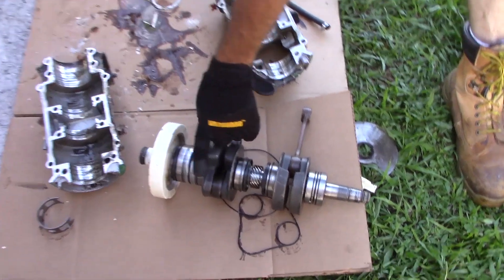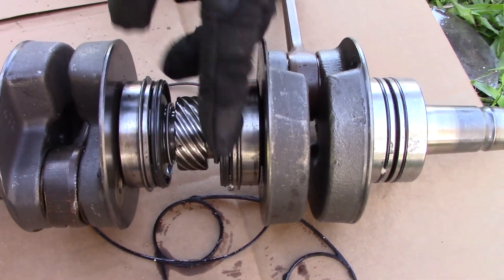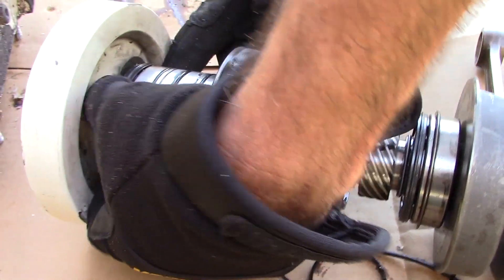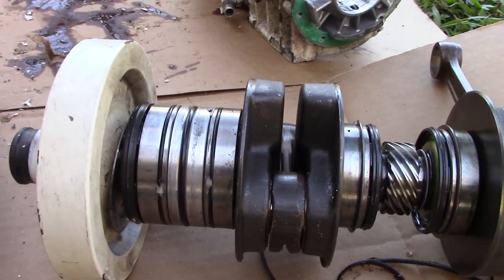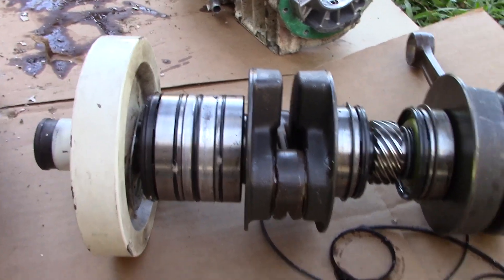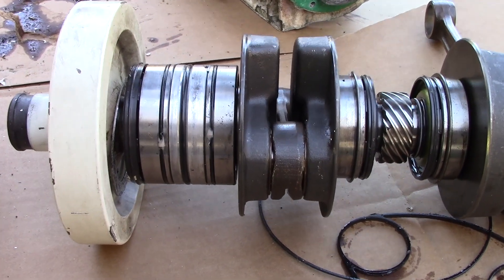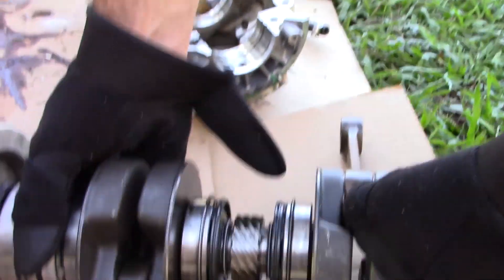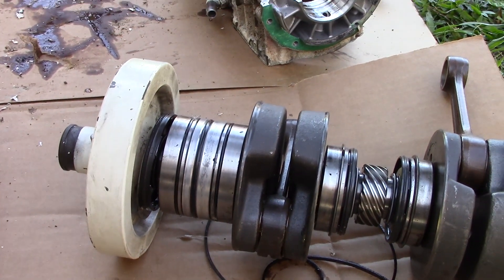Here's the one I got on eBay, which is in good shape — it's just been sitting a little bit, dusty and dirty. You can see the gear here is right in the middle, so the seals appear to be in good shape. The problem is the guy left the PTO on this crankshaft — I don't know how he did it because you've got to take that off to get the case apart. I broke a pipe wrench last night and it took four guys to get this off with an eight-foot cheater bar off the engine. I've got to get this PTO off in order to finish this, so I might have to go to Chris's house with the tool I ordered and try to impact it off. That's where I'm at right now.